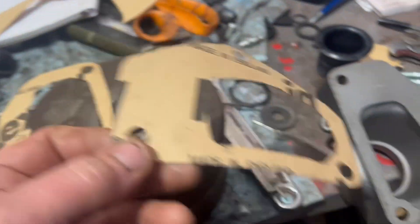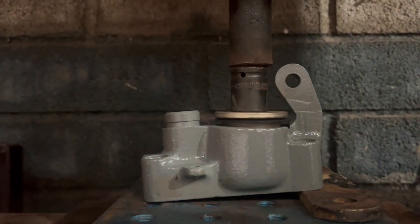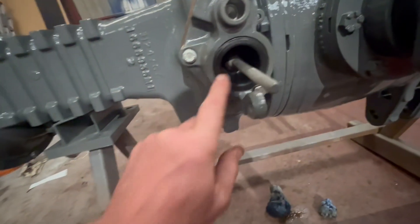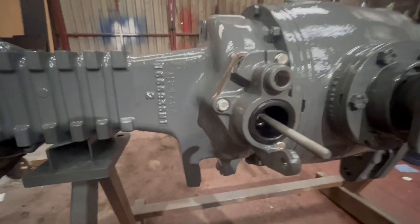Saturday morning — where did Friday go? It's been a bit wet overnight, rather a lot of rain. Anyway, we're down here making gaskets. I'm going to try and get the slave cylinders fitted back on that front axle now. We've got the seals to put in, then we get those bolted on. Had some gasket paper, made some new gaskets for that. We've also got the ones over there painted, and we've got the boot seals to go in. We'll go and get those in the press, squashed in. Nice new bolts and washers — we can get these put together. I've got it wedged up a bit on one end because the face isn't square to the bottom, so that's pretty well square to get the press in there and pop those seals in. There's one fitted on, we've got the seal over the rod in the middle, all bolted up — that'll stop the oil coming out. We can get the boot to go on there and the pin to sit in there. I'll see if I've got a spare arm that's already galvanised to fit on there — then that's pretty well finished.